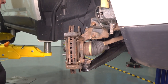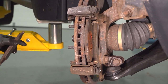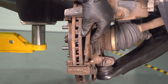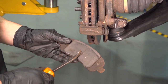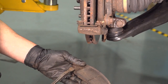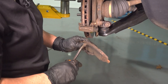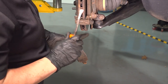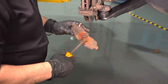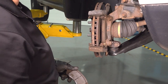Let's get the pads out of the way. That's what we call the outer pad and this is the inner pad. It's always good when you do a brake job to pay attention to how it comes out. The indicator is on the top, and that's exactly where it should be — you want it on the closest surface as it rotates around. I want to look at the angle and confirm it's evenly worn all the way around. That will also tell me if there's a problem with the bracket. This has been changed before — it's not factory, because you can see that aftermarket orange goop. That means these pads fit properly and slid back and forth smoothly.